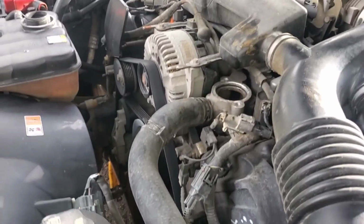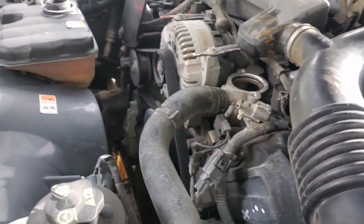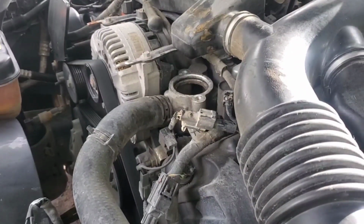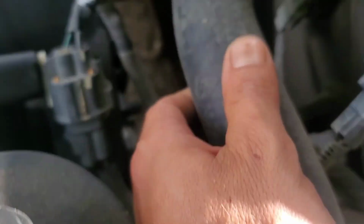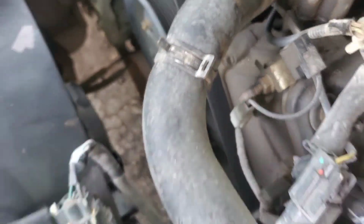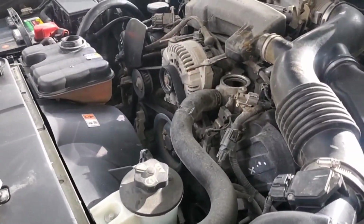Well, this has turned into a little bit bigger job than I originally planned on doing, but the car needs it anyway. Went ahead, pulled the thermostat and flushed the engine out with some water, and then I also flushed the radiator out with some water as well. But listen to this. I don't know if you guys could hear that crackling sound, but that hose is definitely brittle.